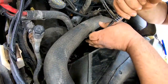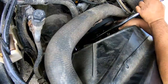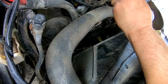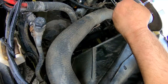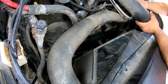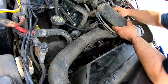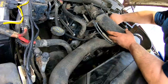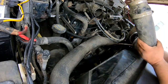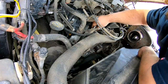This is a half-inch drive for your tensioner. I'm going to turn it clockwise to loosen the belt — we can just peel that up and leave it there out of the way. It's probably a good idea to make sure you know which way that belt routes. These little plugs you just push the little tab in and they pop right out. That's the air temperature sensor there. I'm not too impressed with this K&N air filter assembly — even with me loosening stuff up, it's still kind of tight, which I guess is a good thing.